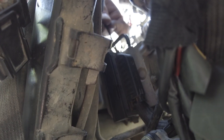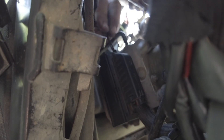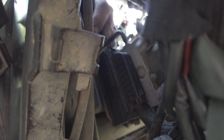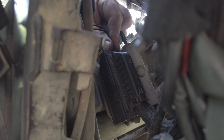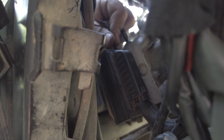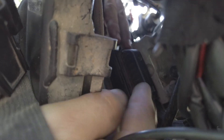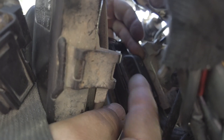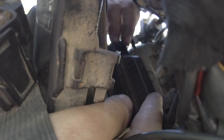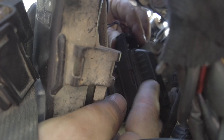One of the hardest connectors was the ABS plug — it probably took us a good half hour of jimmying with a small screwdriver, being ever so careful. We actually wired a line to the top so we can pull up on it. When you pull up, it releases it a little bit, and then you have to go in and gently maneuver it back and forth while you lift up. It'll start to come off. This was one of the hardest plugs we had to do.